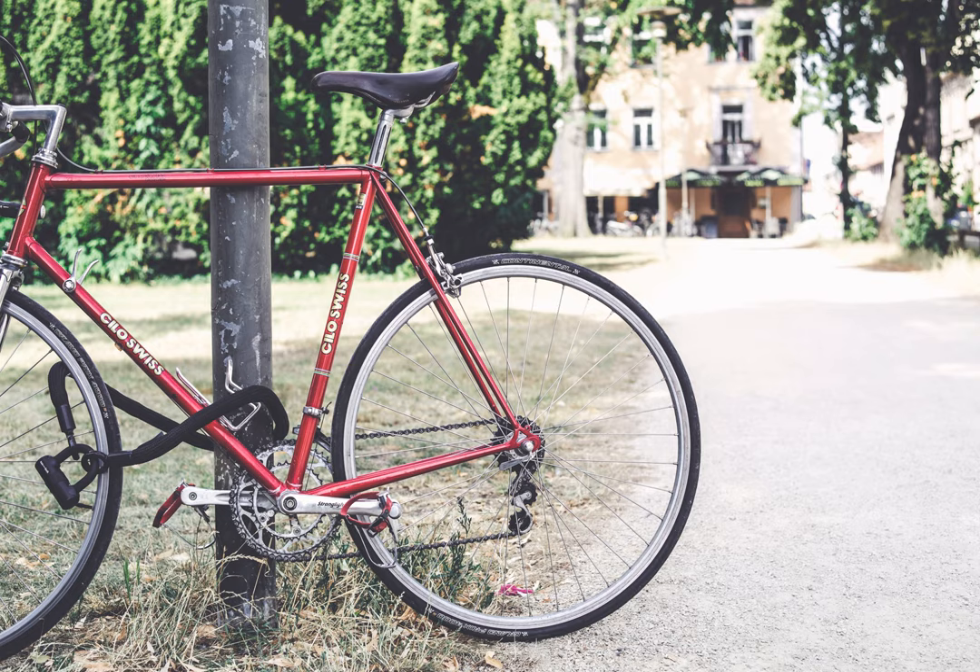Shimano B01s is an extremely cheap but good quality resin pad that would work. The noise and chatter you mentioned is most often related to inadequate bedding. Metallic pads make it worse and will give some noise even when things are going right.